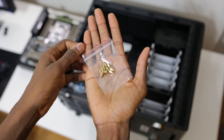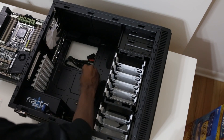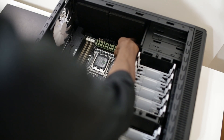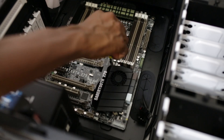There are some golden screws that came with this case. These are the motherboard standoffs that you install into the ATX holes of the case. The motherboard will then rest on top of these in order to separate it from the metal of the actual case, and then we get more screws to screw the board into place on top of these standoffs so that it's held snug.